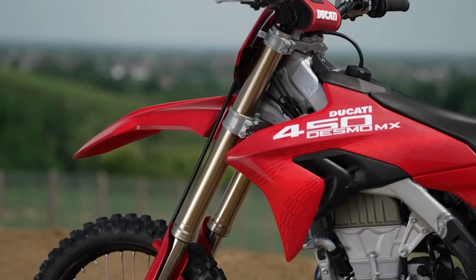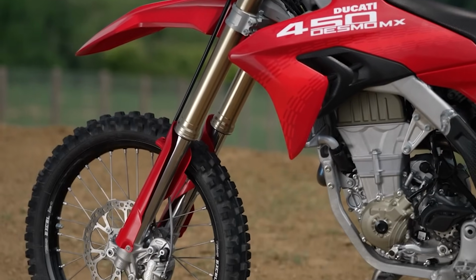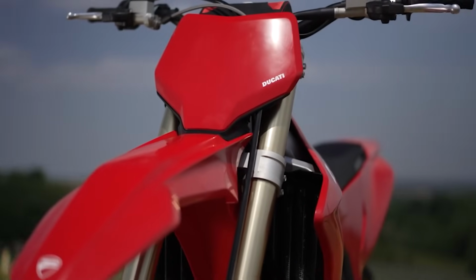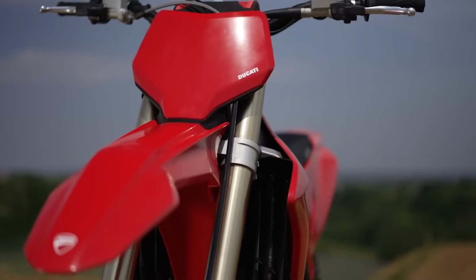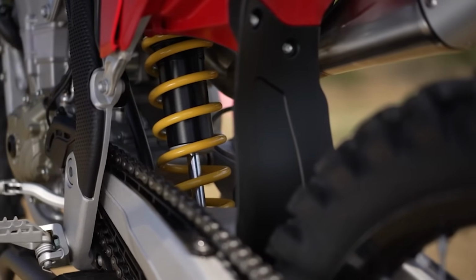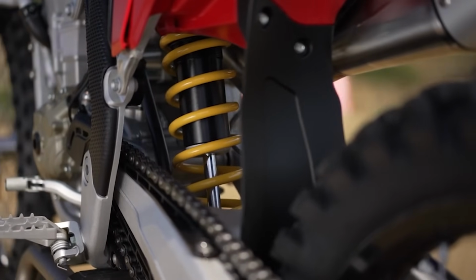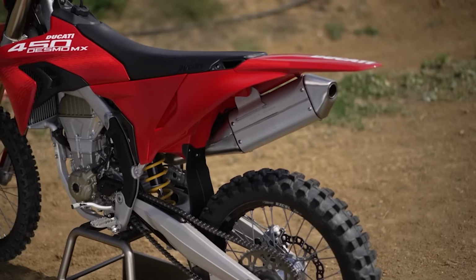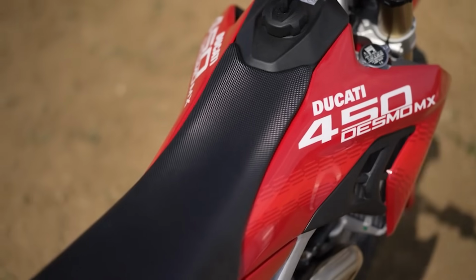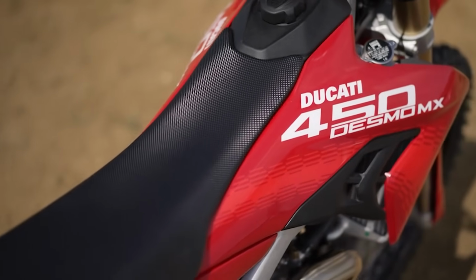On the suspension side though, I still could tell a little bit more. Again, it's not very rough today, so in terms of actual comfort or harshness in places, not too much, but overall balance. Like most OEMs, we're talking about a 105 millimeter baseline. I ended up a little bit below that originally. I think at 108 is where they set me. I came back in and still added a little bit to it, turn-wise, because I had, again, a little bit of pitching this morning.